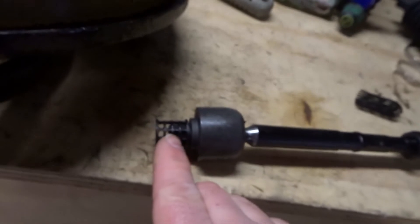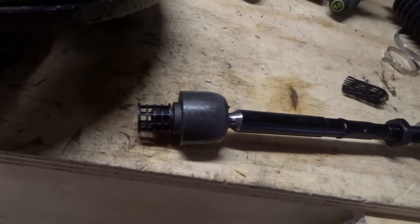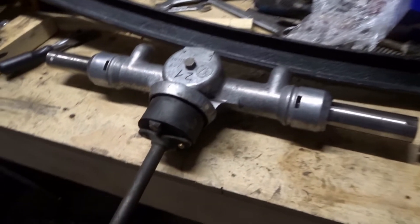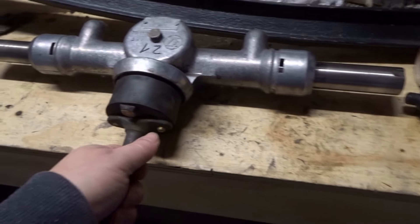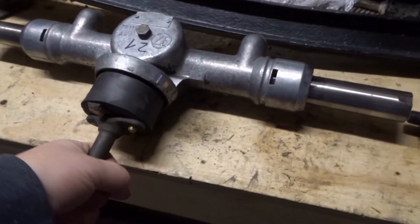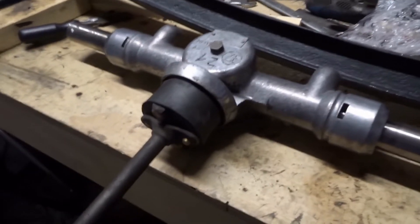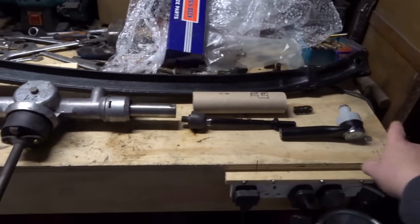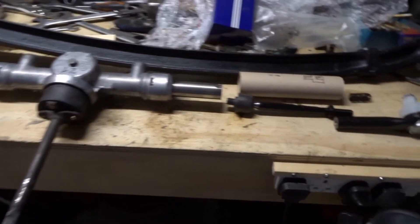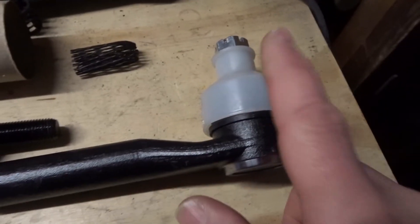The question is whether that will go into the early Porsche steering rack. The good news is my early Porsche steering rack seems to be in good condition - it's not complete junk. I can turn it easily, there's no slop, it doesn't bind, it's not a rusty wreck, and even the rubber looks pretty good. The dimensions, once it's all bolted together, will be correct.